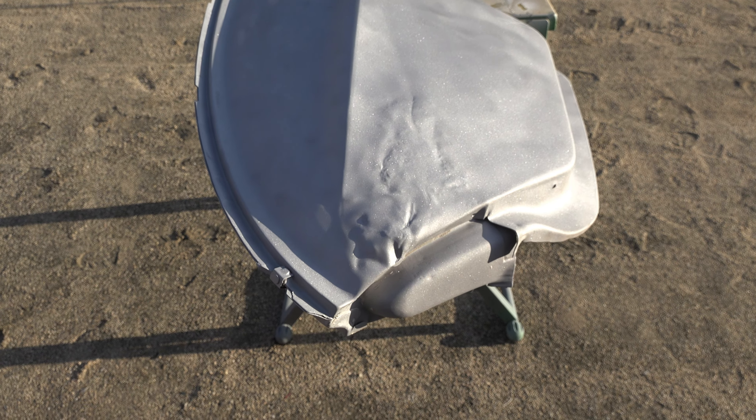While the passenger fender was in much better shape, it did still have one deep dent on the bottom. I go ahead and pull this dent out with the stud gun. With the dent removal done on both fenders, I turn my attention now to the holes on the driver's side fender. Unlike the person who previously restored this fender, I will NOT be filling these holes up with Bondo. And by the way, NEVER fill up holes with Bondo — I will instead weld these holes shut.